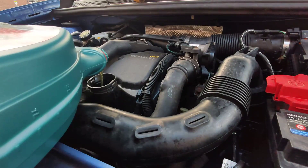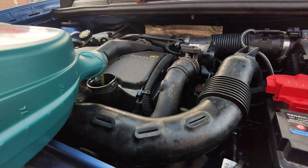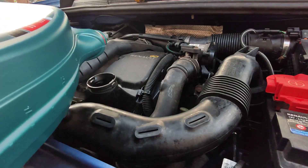As I mentioned, this is a dipstick and filler cap combined, and it's pretty narrow, so it takes a very long time to fill. If I try to fill any faster it's just going to overspill. Also, when you go to measure your oil level it's not very clear, because the walls of the filler cap are all covered in oil, so your whole dipstick is going to be covered in oil and you won't really be able to tell.